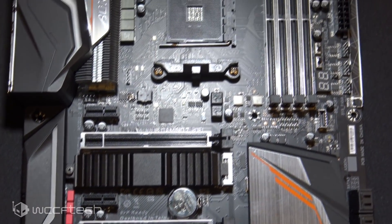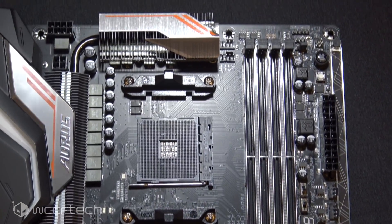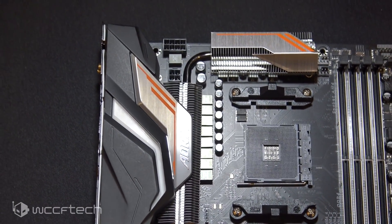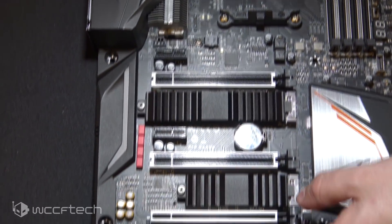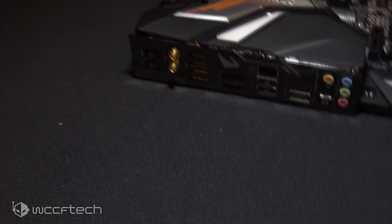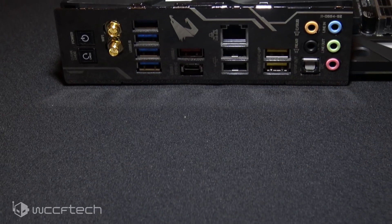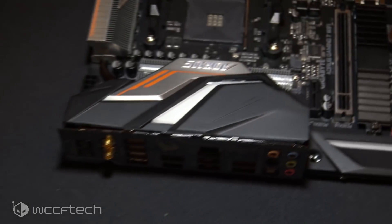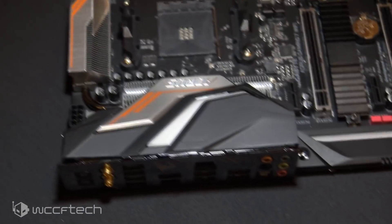If this board goes well, this may be my new motherboard. They've got a 6mm direct contact heat pipe with an actual aluminum fin array heat sink — no aluminum chunks or blocks. I wish more people did this. This likely comes out of the X299 era where VRM heating was a big issue. If we start to see more of this design on more motherboards, hopefully we won't see that problem again.